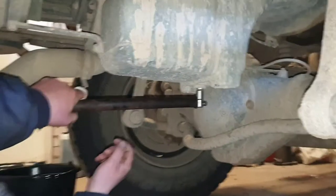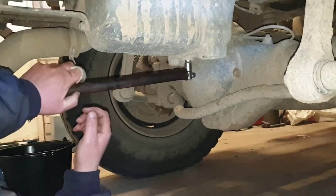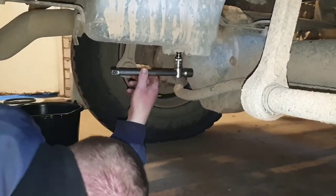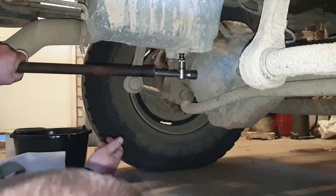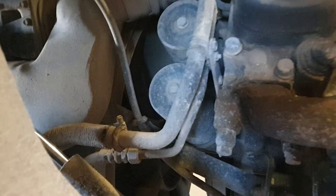Let's start. First we need to remove the old oil from the engine by unbolting the drain bolt on the bottom of the oil pan. That bolt was stuck so badly that we broke the M14 hexagon bit. We managed to unbolt it after heating it a little bit. To make the oil spill out faster, remove the oil filler cap at the front of the cabin while the oil is draining.